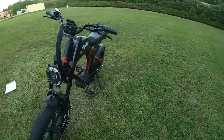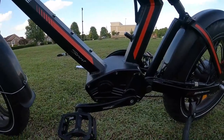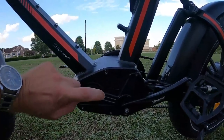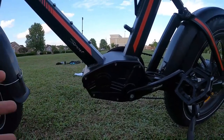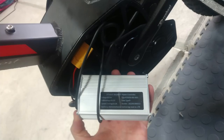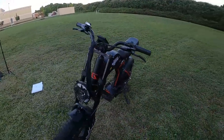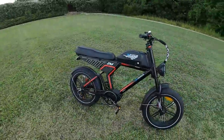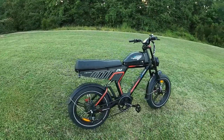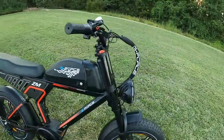There's a large plastic cover on the frame that looks like it might house a mid-drive motor, but it doesn't. I opened it to find the controller crammed inside — it's a 22 amp controller. With a 48V battery and a 22 amp controller, you're looking at roughly 1,000 watts or a little over for peak output. It was fairly easy to access if you ever need to get to it.